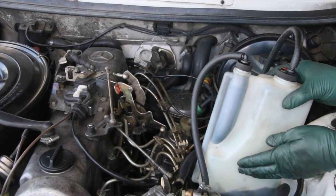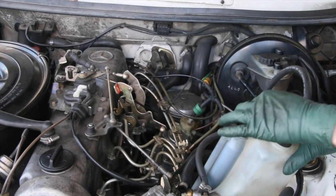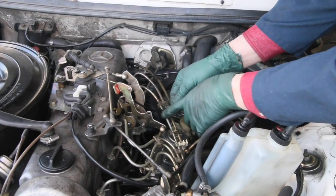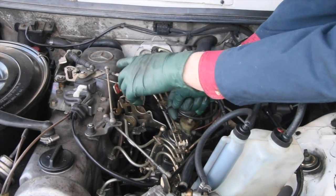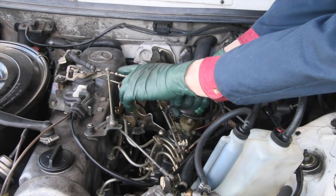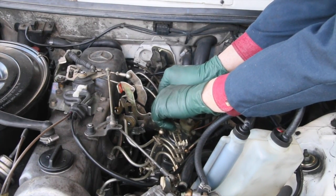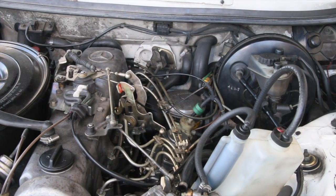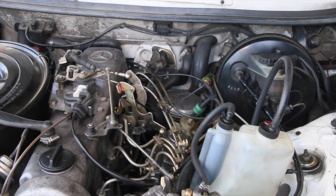During the last half of the purge I tilt the bottle to make sure that all the fuel goes to where the pickup hose is — you don't want to run this dry and suck a bunch of air into the system. I also get a zip tie and hook it to the throttle and to the hard lines on the fuel injectors to let it idle a little faster, rather than having to hold it at a higher idle speed. Just keep in mind when you're running it at this speed you're going to go through the purge a lot faster.